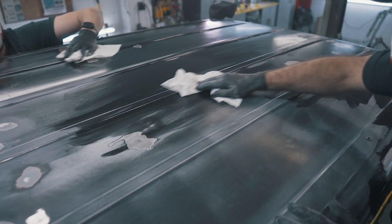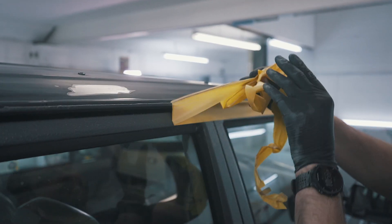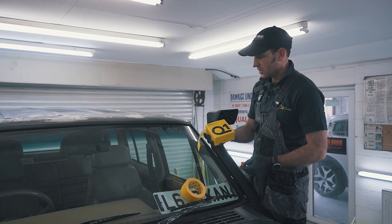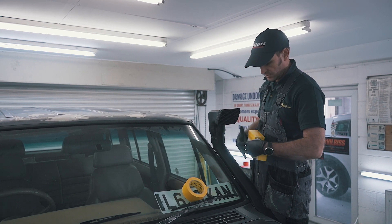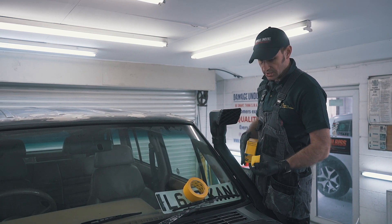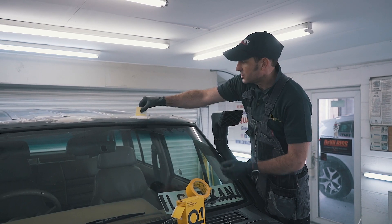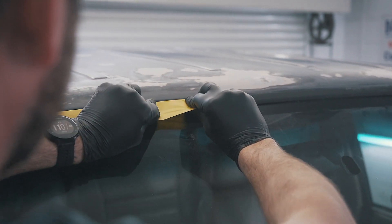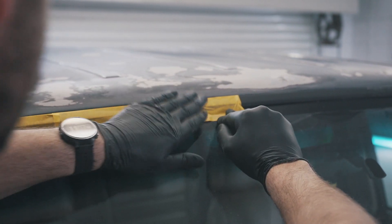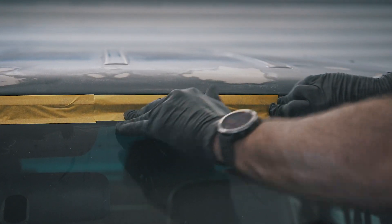Adam, now that we've got the roof ready for paint, we're just going to mask it all up. We're going to use the Q1 Premium Masking Solutions trim tape. It's a really good product, cuts off quite easily. You've got a hard plastic edge along there which tucks in and then you can pull the panel back. When it's in place, pull back the adhesive protection and then just pull that down and stick it in place.